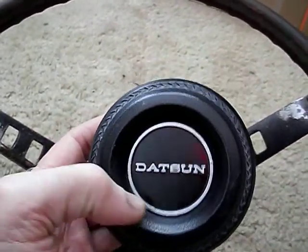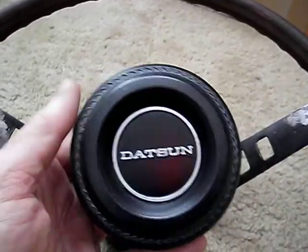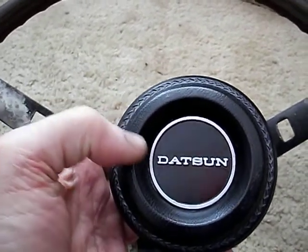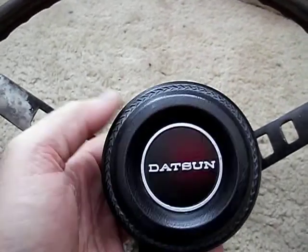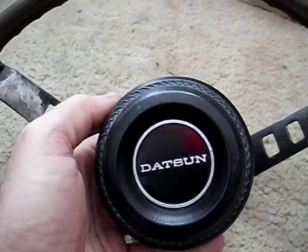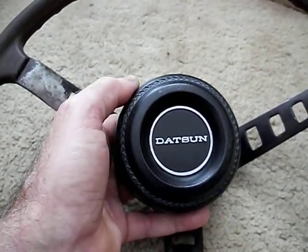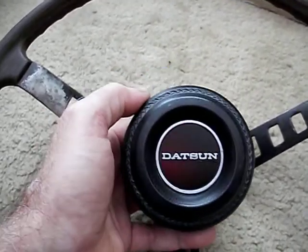When I did that, I masked off all around the plastic bit and just painted right over those edges because there was no way I would salvage it — the chrome was kind of screwed up anyway. Then painted the whole thing black. I put the tape back around the edge again to protect the vinyl part and used a silver paint pen to go over all the edges. It's not chrome, but unless you're really going for exact originality, I think it'll present very well once I get it installed in the car.